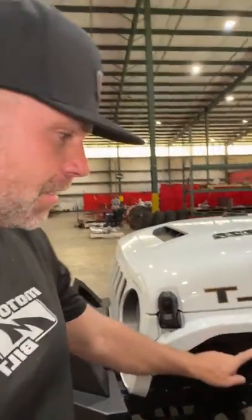Regarding materials on the fenders — the outer fender itself is steel and our inner fenders are aluminum. We chose to stick with steel on the outside for sheer strength. Sure, aluminum saves a little bit of weight, but if you get into rocks and trees and things like that you're going to bend them up, and we don't want that happening. We want to build a product that's going to hold up when you take it off-roading.